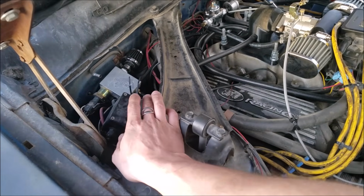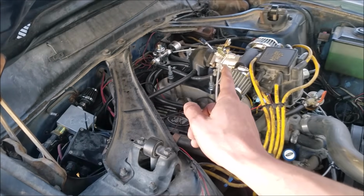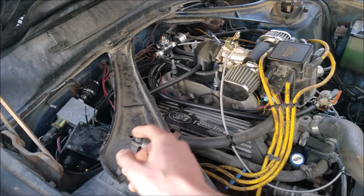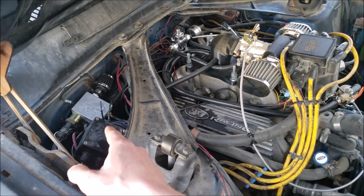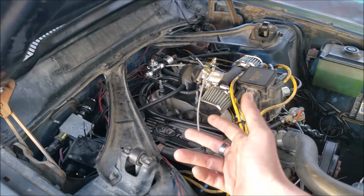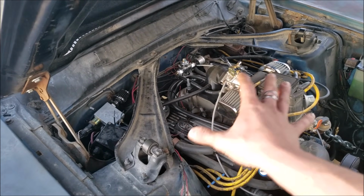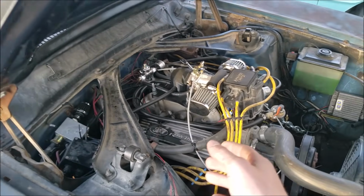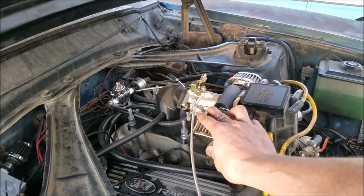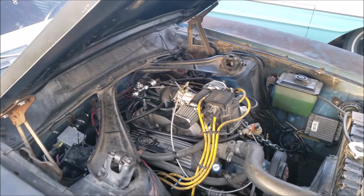And our little cherry on the top that probably made this thing as efficient as it is and kept our air fuel ratio where we wanted it to be. I knew it would work out pretty good, and I'm super curious how it'll work out on a normal 4-barrel. As far as having dynamic control of a static metering carb, maybe that'll play well. It sure worked way better on this lawnmower carburetor thing than I ever thought it would. I'm just kind of blown away with the whole deal.